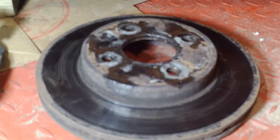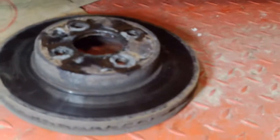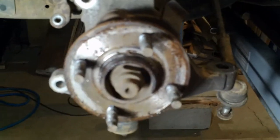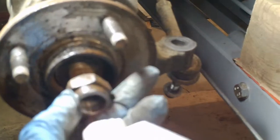The rotor's off. I had to spray WD-40 in the bolt holes and around the axle and tap on it to work it in — and then it came off. I put anti-seize compound all over that thing when I put in the new wheel bearing a few years ago, but it did not come off easy. Next I'll take off the axle nut — that came off not too hard, 30mm socket. Then I'll take the lower strut mount off; there are just two bolts with nuts on the other side.